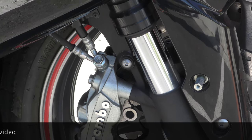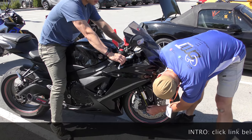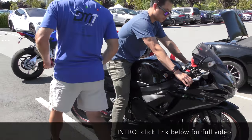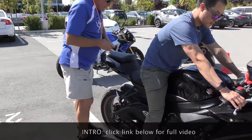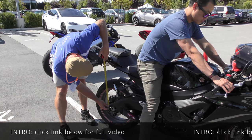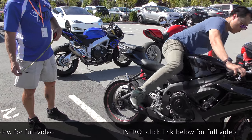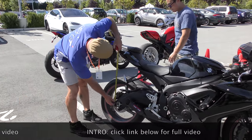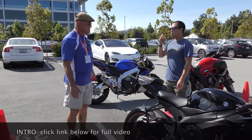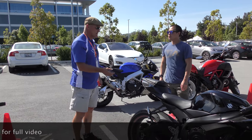So hold the brake on for me. You are at 30 millimeters. 40. Dismount. 70. So you're at 30, 30. So stiff — the forks show that it's too stiff because you're just not getting the travel.